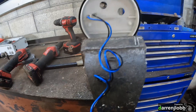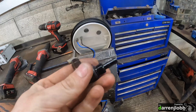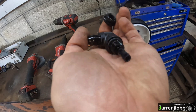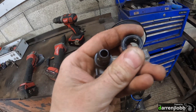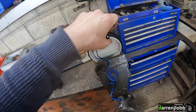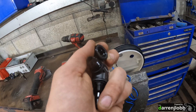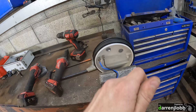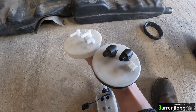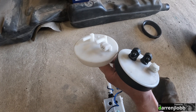With a bit of work with the die grinder and drill, I've removed those two factory stickouts and enlarged the holes to 14mm, which allows these adapters to fit through. There's an O-ring in the fitting and also an O-ring in the nut, so these give a really good seal even if you haven't got a perfectly smooth surface - although we do have two nice smooth plastic faces here. That's pretty much the easiest way I've found to convert these fuel tank pickups from a clamp-on hose style connector across to an AN fitting.